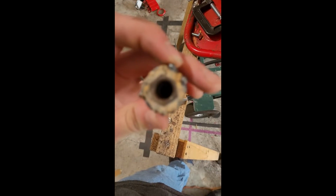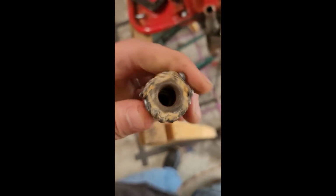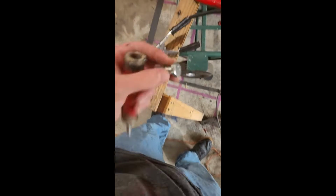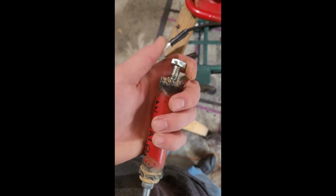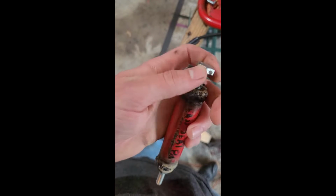So what I did is I had these bolts and nuts from the original suspension. Then I took this bolt and put it through the nut, because it didn't fit. See, it didn't fit in there. And then on the inside, I welded the nut that fit this bolt.